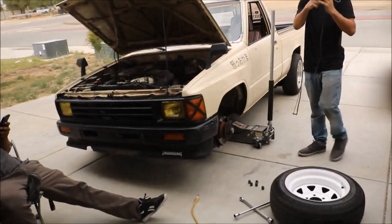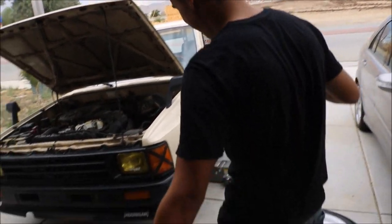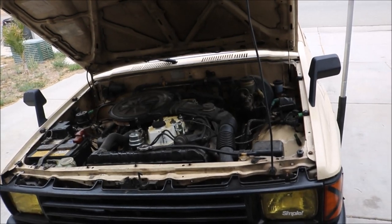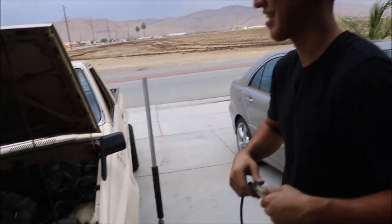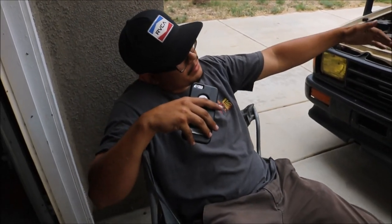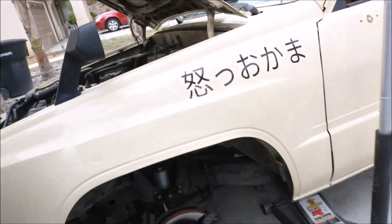All right guys, that project is out of the way. My boy's working on the truck — got it jacked up with the wheels off. What's going on? Drilling some stuff? You know it never goes well when you gotta pull out the drill. Like Leo said, 240s have the same problem — the wiring harness hangs under the wheel well on the inside, so when you're super low your tires rub on it. So people drill holes on the side to reroute the wires. It happens when you've got fat tires.